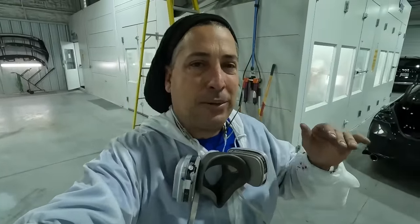All right, so that's one coat of base, and we went with prime on that. Prime looked the best. It was a little bit light, so it wasn't vivid enough to me. So what I did was I left out some of the trace white, which is a 402 in the actual PPG system. I left out about 8 to 9 grams of white on the ground coat, which is going to make it darker, and that's going to let it be more vivid.